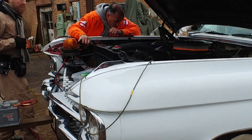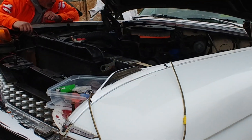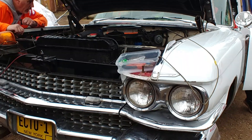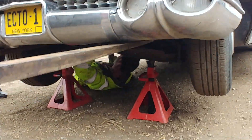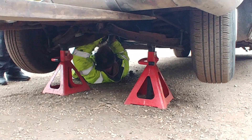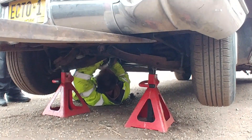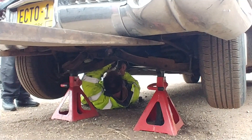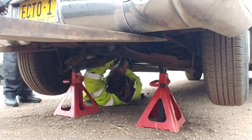It is glowing dim. So whatever that circuit is, you've got to follow that blue wire, Cole. This one? Yeah, that blue wire going up — it turns into the car, doesn't it? It should go to the key side, but it might go to a relay first. Because that one, when you do it, the bulb literally just starts to glow and that should be a really strong signal.